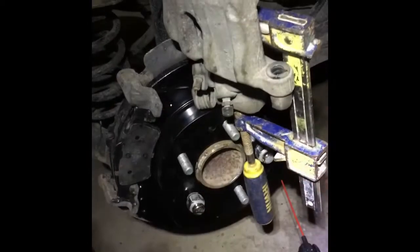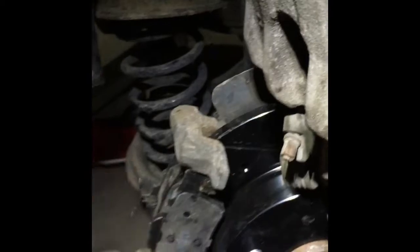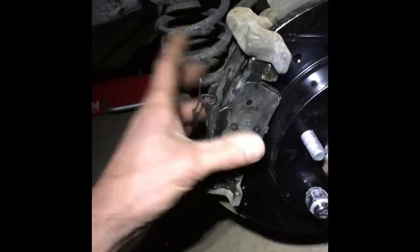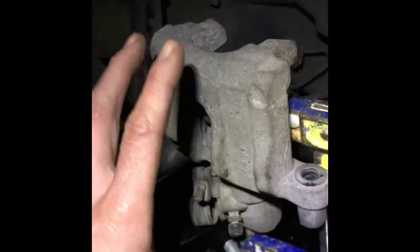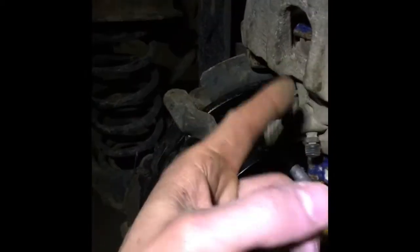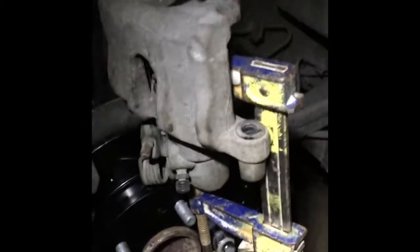So guys, I got in a little trouble because I didn't realize I didn't really squeeze that piston all the way in. Now it's in finally. I put the C-clamp right here. I put the brake pads, right, and basically I wasn't able to put this clamp on top of it because the piston wasn't squeezed enough. Now I found a different way.